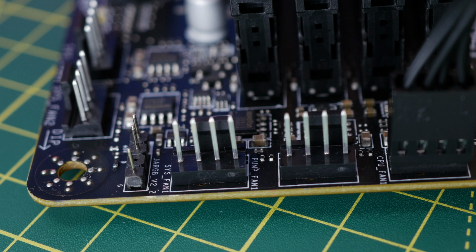If we need to power those fans as well, then maybe you want to get this as an extra purchase too. This is a Thermalright fan hub, so it's a fan controller with PWM controls, and you can see you can plug in 10 fans to this. It has much the same logic as the RGB controller in that it requires SATA power, and obviously you connect all your fans to it from the fan power cables, and then there's a PWM input on the end, which the cable is included with this, and then you plug that into that, and then plug it into a system fan header on your motherboard, then set it to PWM mode, and then you can control the speed of all the fans from this single controller.